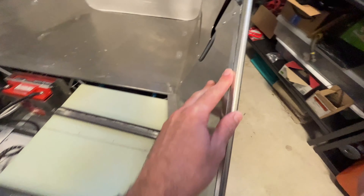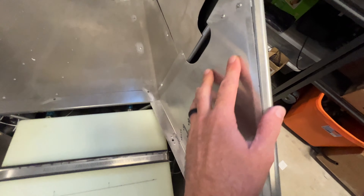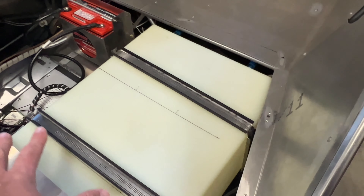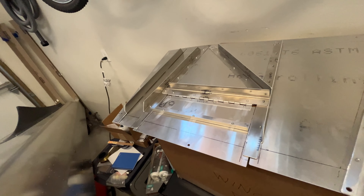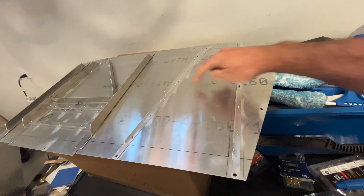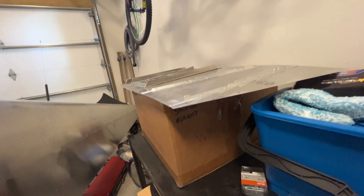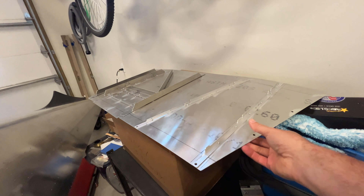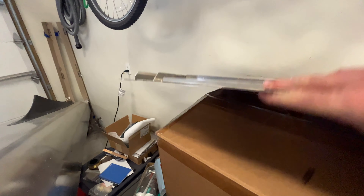Once you're done with the header tank, this next piece requires no effort whatsoever — it just kind of fits in. I bent it here and also bent right here, and it's fitting really nicely. Get that riveted in after you get in some nut plates. Then you want to start working on the forward baggage floor. I definitely strayed from the instructions here — Rand says you don't need these two stiffeners because it could sit on top of the tank just fine, but I wanted the added structure. Yeah, it's going to be added weight, but my dog's going to be back there and I don't want him pushing on this thing and having it bend down onto the fuel tank.